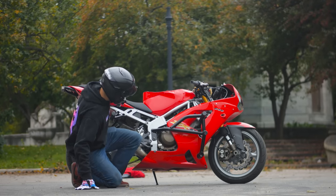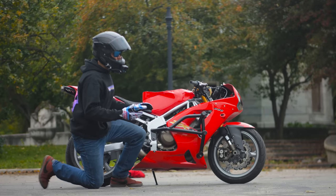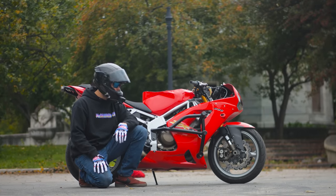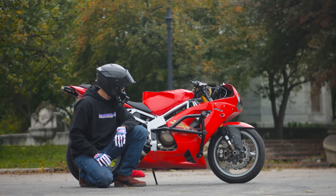I always run a little bit of extra oil — I run it to the top and then some. I fill the sight glass all the way to the top and add an extra 0.2 to 0.3 quarts. And I always put a little bit of Lucas Motorhoney in her. That's how she stays alive, good, and healthy.